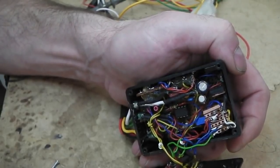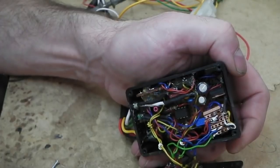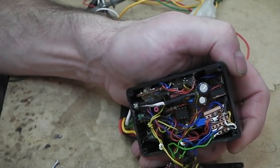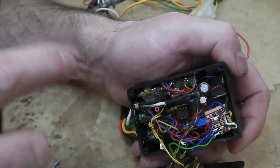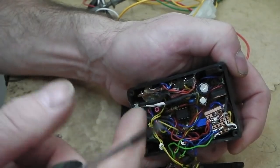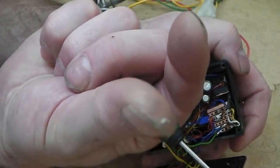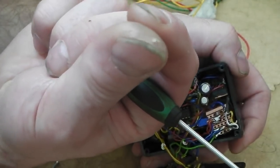Connect a 12 volt relay to a power pack and you'll hear it click on. Drop your power pack down by putting it through a bulb or something, and the relay will still hold right down to almost hardly any power. Then it'll finally drop off. But it'll never come back on at that low power level. It always needs the full power level to get back on. It's to do with the way that a relay contact closes. It takes a lot of effort to close it, but not much to hold it.